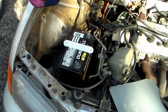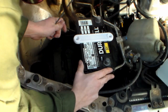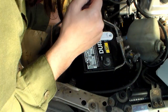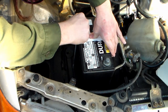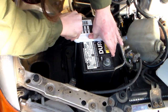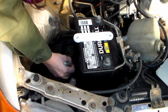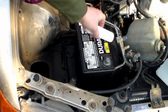Down here is the bottom of the plate and up here is where the strap goes over. I'm going to move this battery just a little bit to make it more even and realign this. Now that it's aligned, I'm going to hold the strap and back this out. I'll hold it with my thumb, put the stud down here, get it lined up with where I could drill a hole, and turn it to mark the spot. Now we've got a spot marked — I'm going to take a Sharpie and circle that spot.